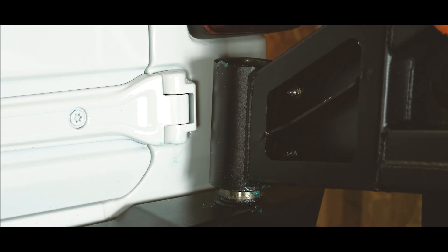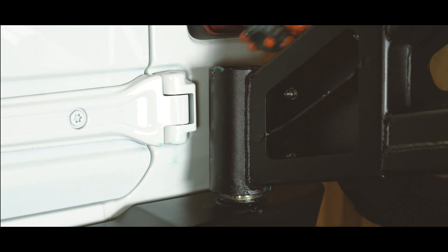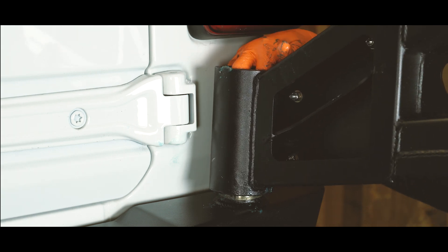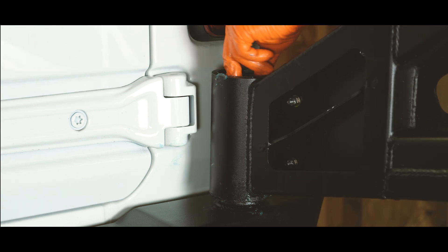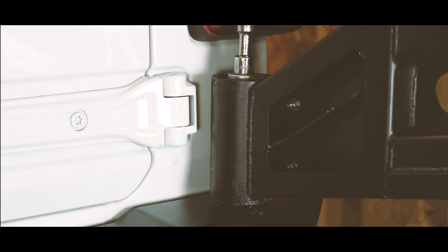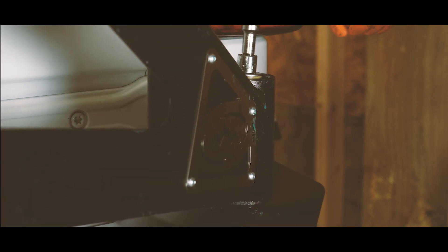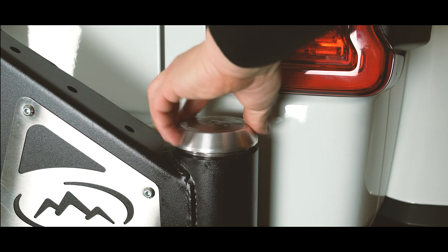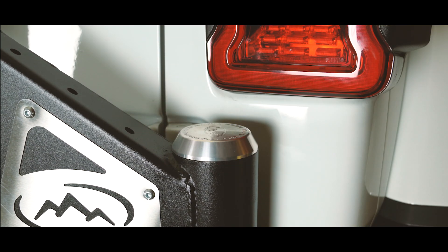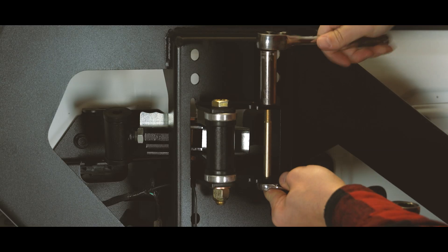With the bumper portion wrapped up, we moved onto the tire carrier swing arm. After greasing the bearings, we set each one inside of the arm, then gently worked the arm onto the post until it was in the correct seated position. Once this was accomplished, we tightened down the assembly — you don't need to overdo this, as you'll want the arm to be able to swing easily, making it where it can open and close without a lot of effort. To ensure that debris doesn't get into the bearing assembly, Expedition One provides a seal at the base of the arm and a threaded cap for the top.